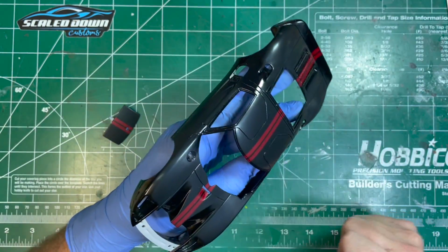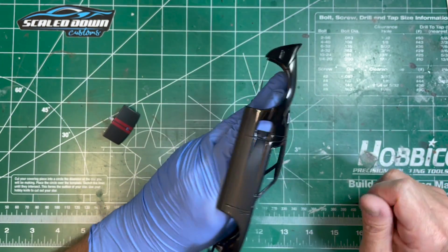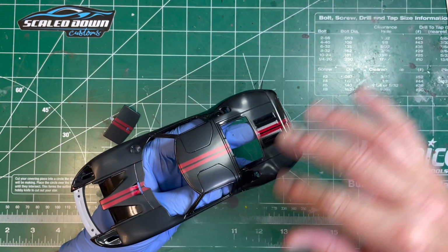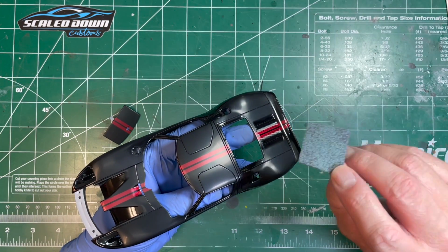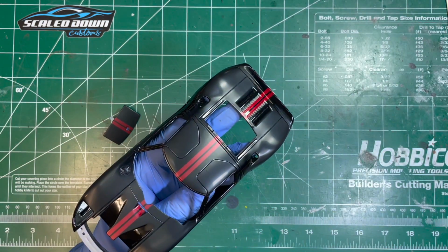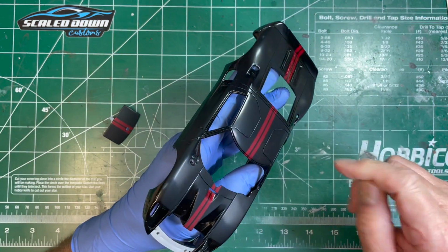Alright, so I got all my dust spots sanded down, as well as some of that orange peel. Just kind of got everything smoothed off as much as I want. And after I did the 3000, I went over it again with a 5000 just to take out some of those deeper scratches from the 3000 and make polishing a little bit easier.